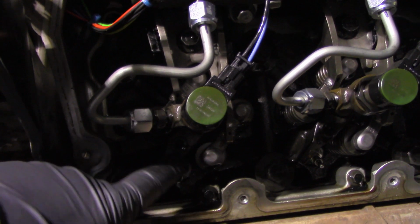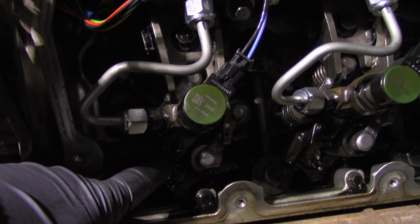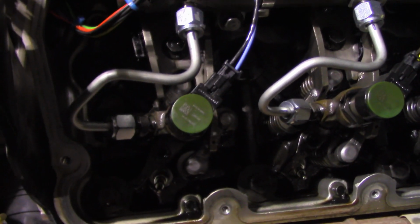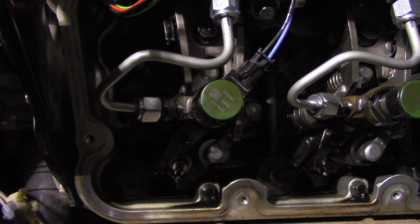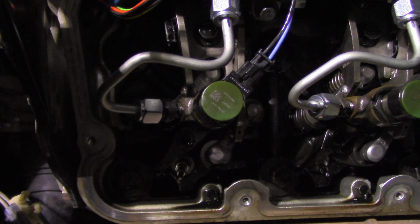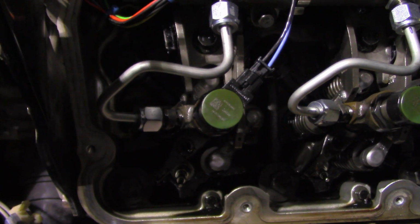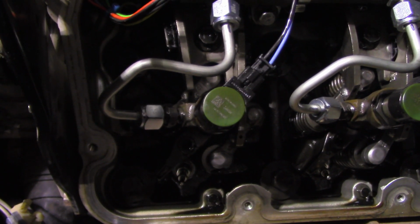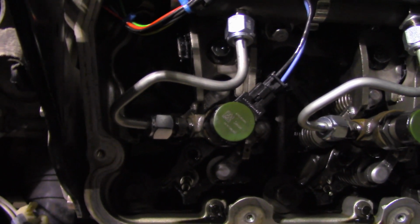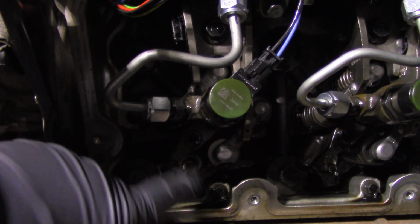Then you want to torque it. I believe the initial torque is like 18 inch-pounds. It's something ridiculous. You guys will have to look it up. I'll actually link in the description below a link to a PDF that has all the torque values for this truck. It has wiring diagrams, has all kinds of stuff. It's great. I found it on the internet. God, I love the internet sometimes. But you'll use this to torque it down to 18 inch-pounds.